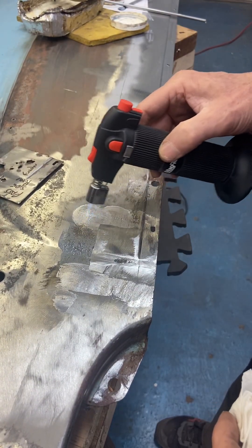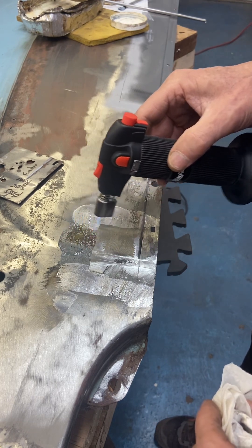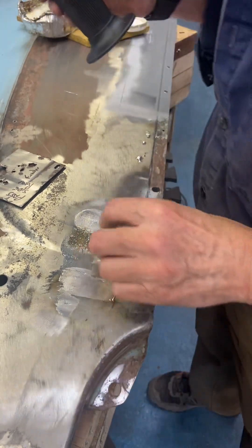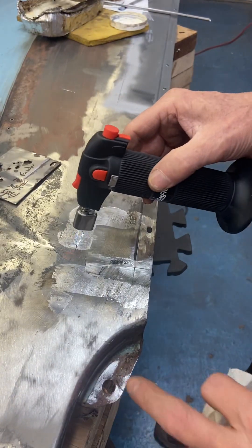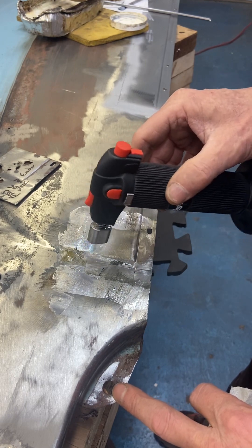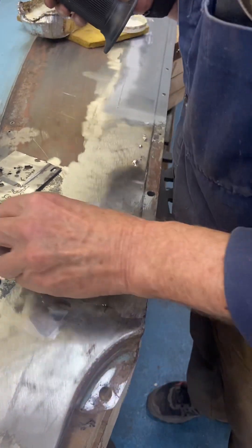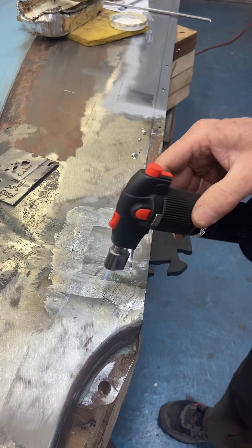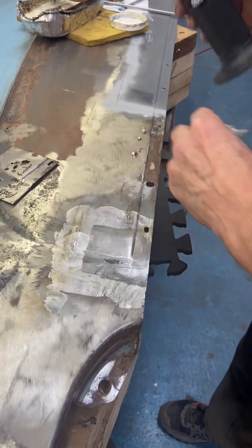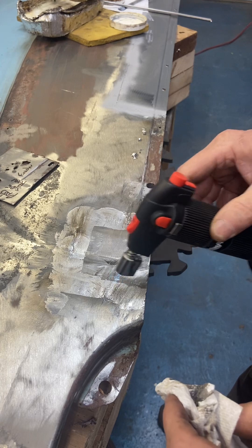The idea is to get the panel very, very clean. After I had welded the panel in and was happy with it, I have what's called a vacuum sandblaster and I went over the seams and sandblasted it. That got out any welding residue and this sort of stuff, giving you a cleaner panel. The lead will stick better. We have a little bit of dirt in here — we can probably cover that with the lead.